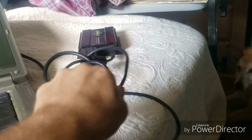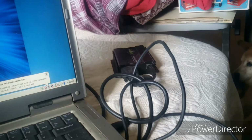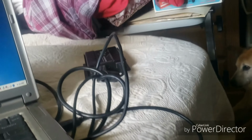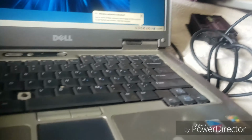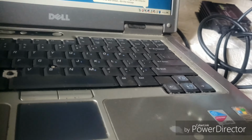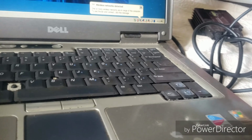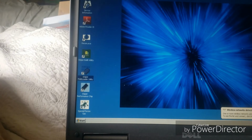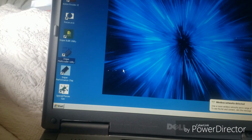And this plugs into your OBD2 port, and that allows you to put your tune on the PCM, but it also plugs into your computer. Now, you do not have to have it plugged into your computer while you're tuning. The only reason you would plug into your computer while you were hooked up to the car would be to data log.